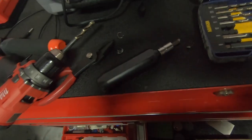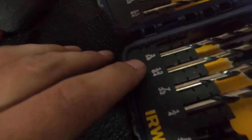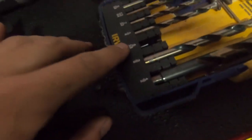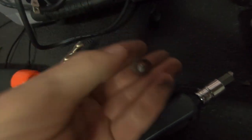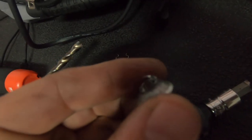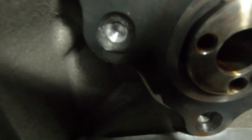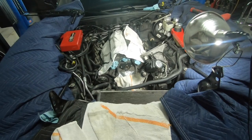The slot and impact bit didn't work out, so we moved to the drilling option. We started with a 3/16" in the center, then walked our way up to 5/16", and basically once we got to that point the head just kind of separated off. We've got two more to go and then hopefully we'll be able to pull the plate off.